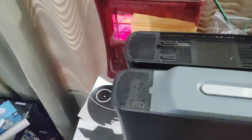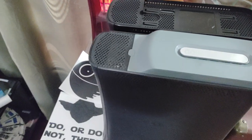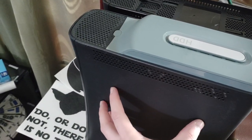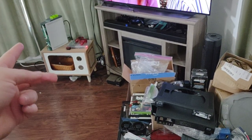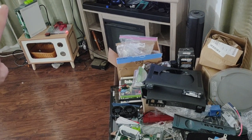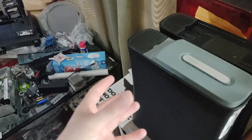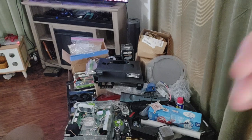That's where we're at right now — I just wanted to give an update. I'm still waiting on a lot of parts; some take quite a while to come in. I can't cut this one yet until I have the fan so I can measure it out. I'm planning on at least cutting that water block to see if I can get that to work, cleaning up all this stuff before tearing these apart, then taking the disc drives out to see if I can clean them and get them working.